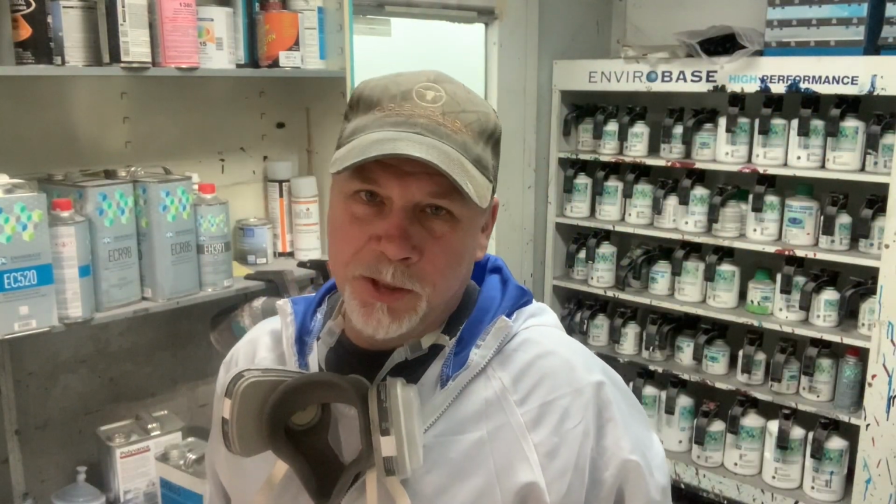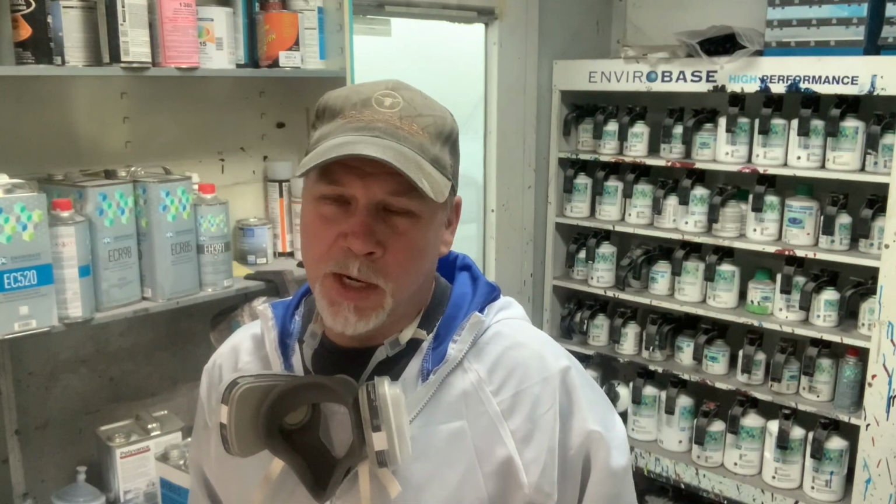All right, so that's the sealer. Sealer's on. We're gonna let that flash for probably 15, 20 minutes, make sure it's good and dry. And then we'll put blue on everything and come right behind that and do our white on the two-tone until it's covered. We'll give that some time to dry and then we'll tape it off and come back with the blue.